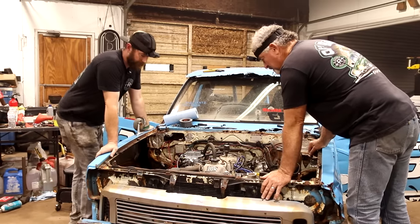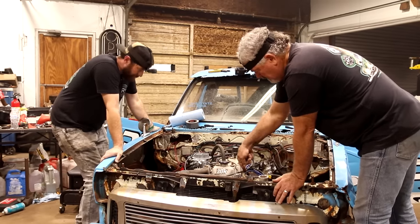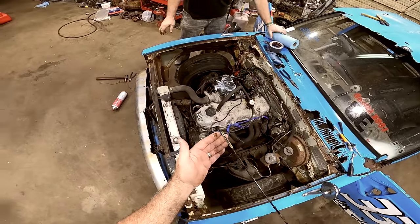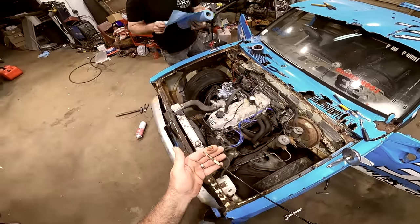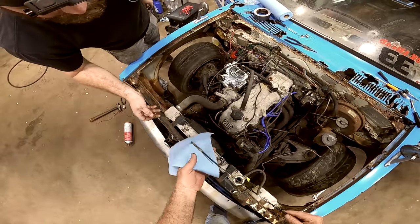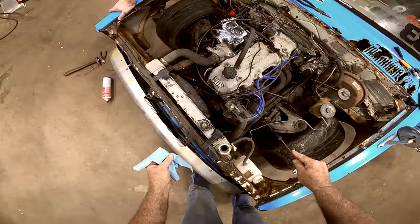Well, do we want to get, what's the oil look like? I know it was milky in that filter. I just want to be sure. Ooh. Is it milky or is it just? It's got a, let me just re-dip it again. It ain't as bad. It's not as bad. Nah, it's funny colored. I think I was seeing a stick through it more than anything.